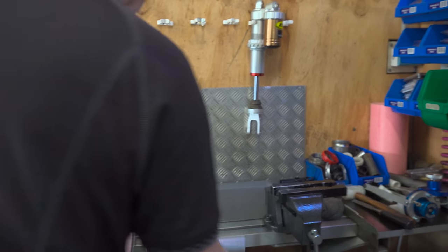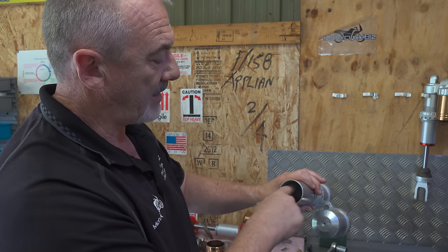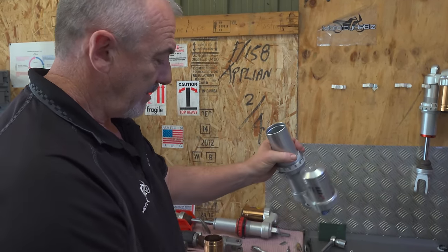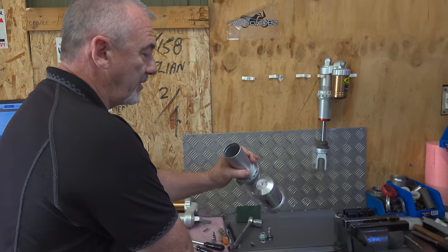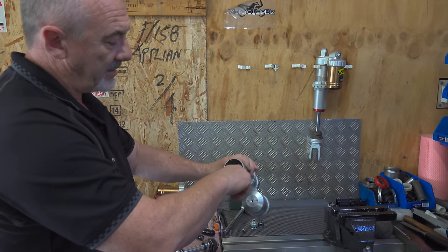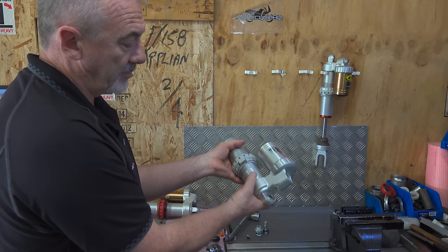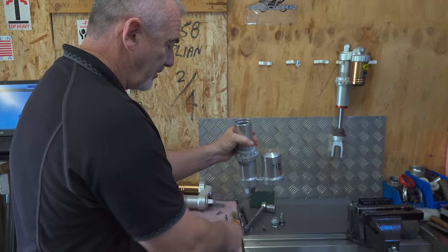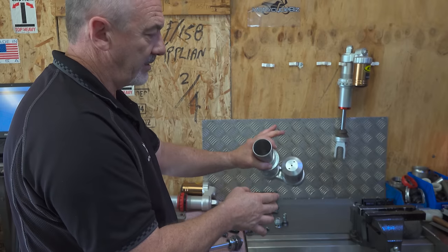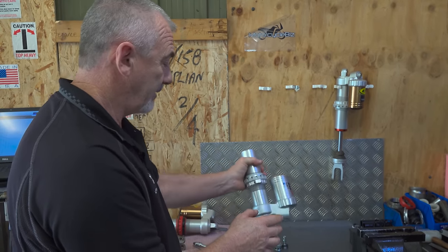It also reduces the drag on the body of the housing itself, which is anodized. So if you don't switch to one of these, within about 100 hours of use, it starts to take the anodizing off the body, and then we have to actually replace this whole tube, which is not cheap. That reduces the drag so much that we find that after a couple of 100 hours, the anodizing's still good. Wow, it's still not worn out.